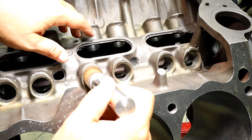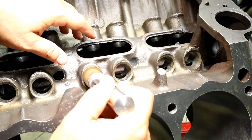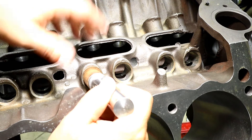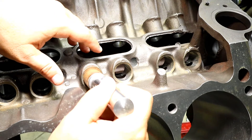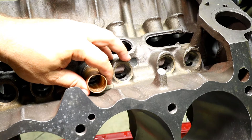Why are we not doing it post-installation? Quite frankly, it's easier to make that drill hole before we put it in there. And once we get it in there, it should not turn — we should be good. We still have to bore the sleeve, that bushing, out just to make sure it fits that lifter properly.